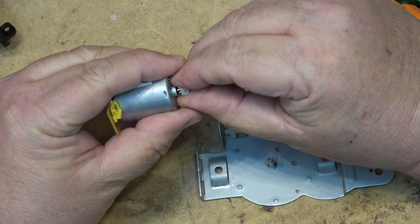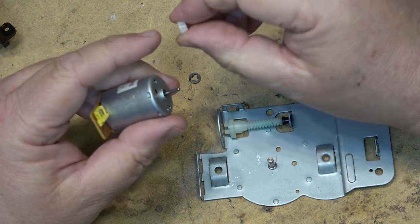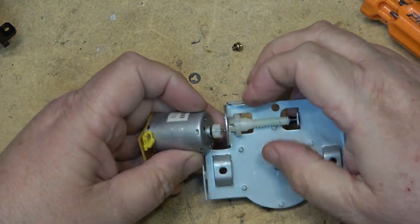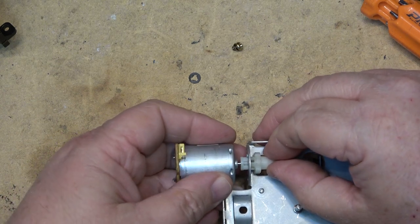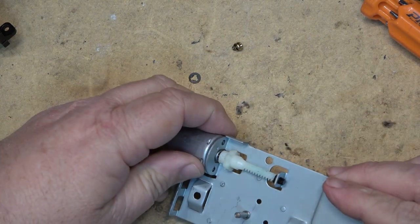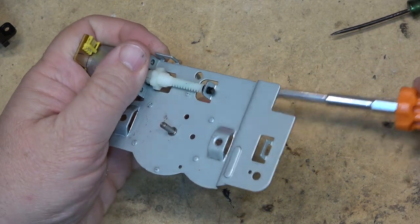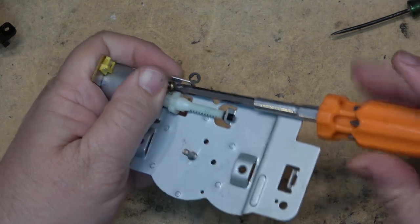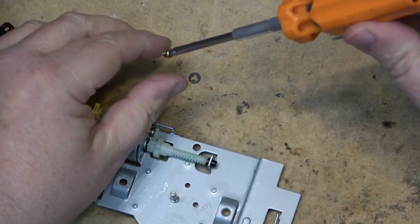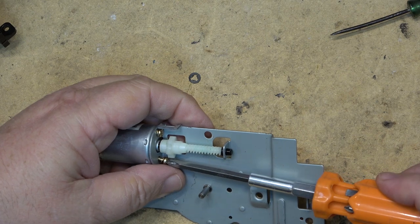This part is not available and hasn't been for a very long time. What we used to do is glue these together — get some epoxy, like quick-set five-minute epoxy. You can't glue them with crazy glue because crazy glue will not stick to nylon. Put some five-minute epoxy on, then set the shaft back in place. You've got to be relatively quick because you only have a few minutes — get the shaft back in place and get the screws in place. Then you need to adjust the clearance before the cement dries.